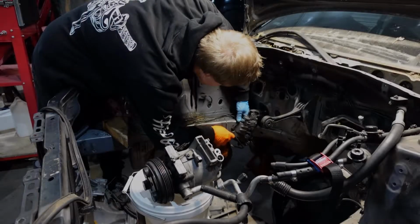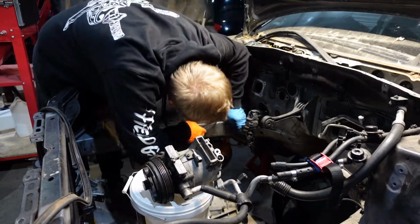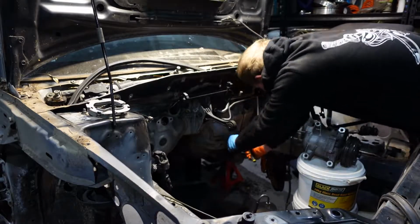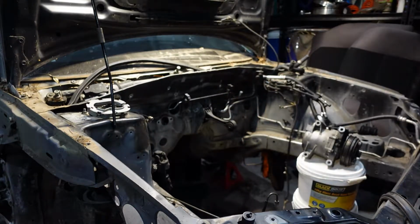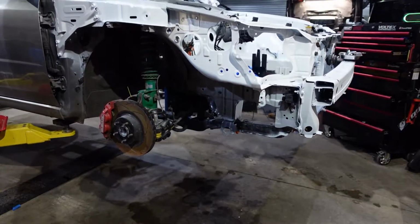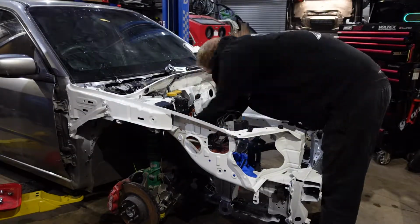Because I resprayed the engine bay, I needed to remove all the brake lines to ensure that I could get good paint coverage over the whole bay. Another thing that happened was, as I was removing the brake lines off the NA shell, the flare nuts I rounded quite a bit. The WRX's flare nuts were in much better condition, so I decided to swap the brake lines over. With the brake lines out of the WRX, it was time to put them into the new shell.